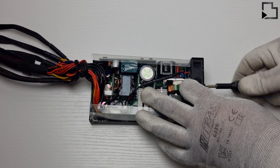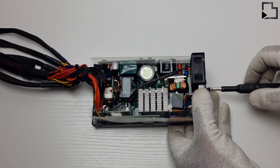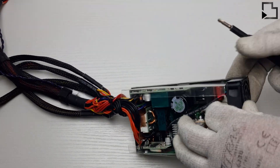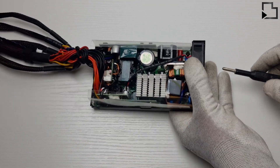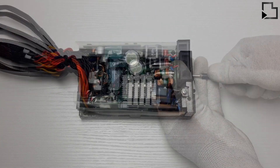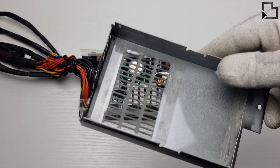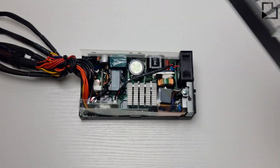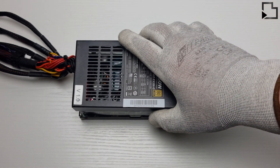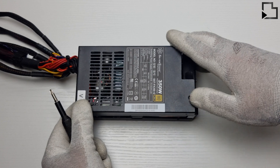What I did was set the fan to intake, as in most cases you would want to be drawing cold air from outside the case versus sucking hot air through the power supply from inside the case. I also removed the plastic that was covering the PSU grille, as it'll help with hot air escaping.